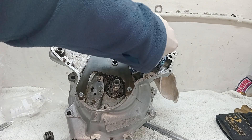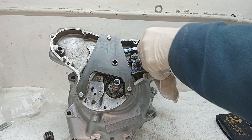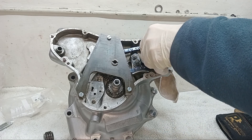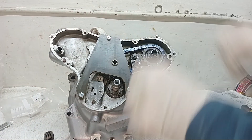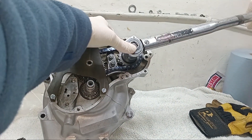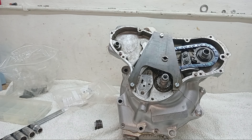Okay, the nut's on the camshaft and I'm going to torque that up to about 15 foot pounds. I notice I've locked the crankshaft the wrong way — it's turned the opposite way — so I'll move the rag to the other side of the crankshaft mouth. There we go, that's locked the crankshaft, it won't turn. We've got the plate in place so we won't damage the intermediate shaft. The nut's done up.